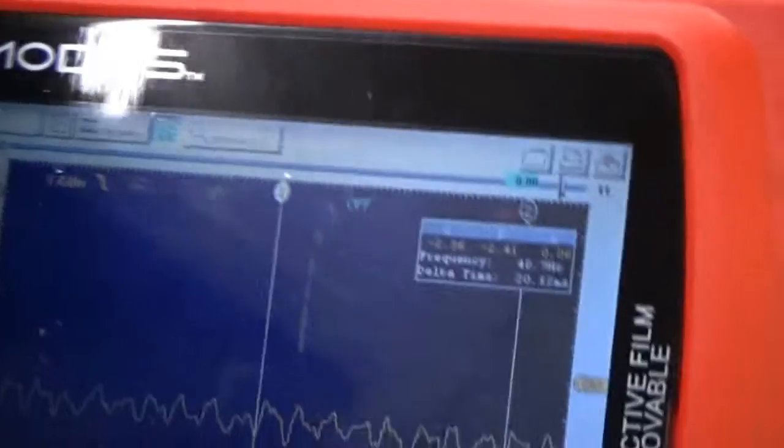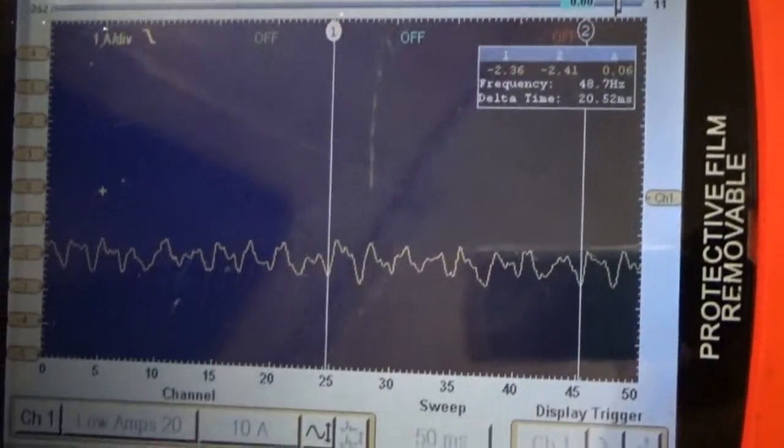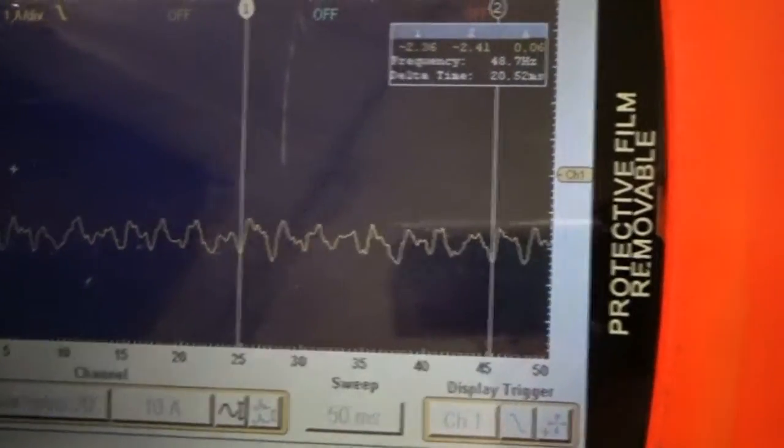The ground is good, and where I got this connected — you see the black wire there — that's the ground for your pump. This thick wire in the harness is the one for the GM; GM always uses a large fat wire to supply power to the pump. So we have good power to the pump and good ground. Doug was calculating with his Modis as part of the learning process with this tool.